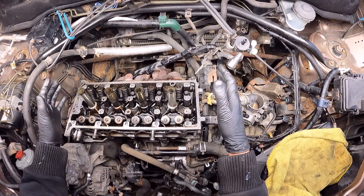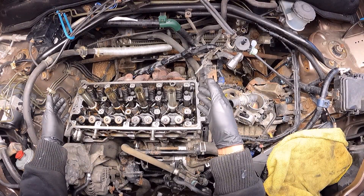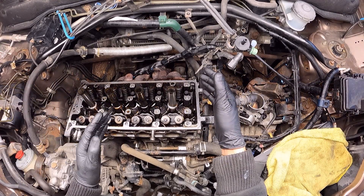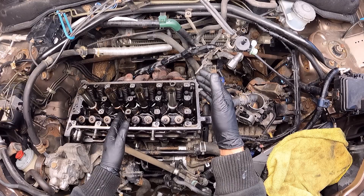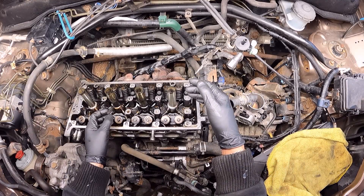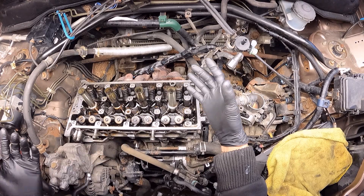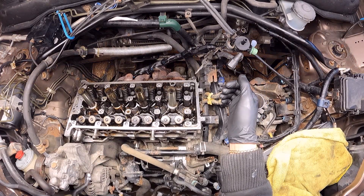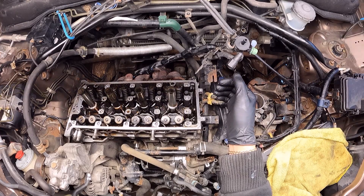With this we're finishing applying the torque to the engine head bolts for this Honda CR-V. As I said at the beginning of the video, what we showed was the sequence that has to be followed — the initial torque and then the three passes spinning each bolt 90 degrees. I hope this video is useful for you guys, and if that is the case I will appreciate if you click on like and subscribe to the channel. Thank you.